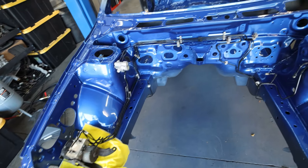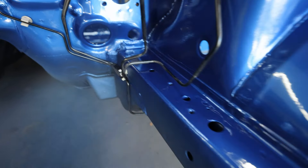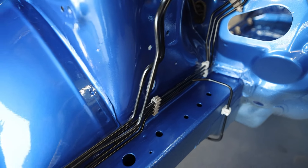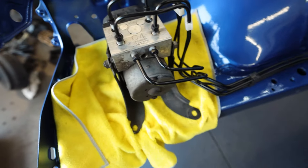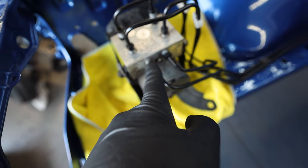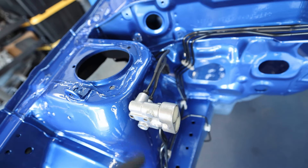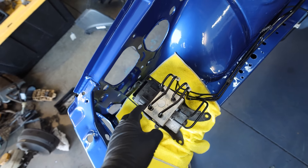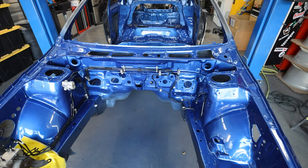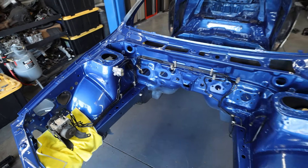It's a little confusing to explain, but you've got this one swoopy line here that comes down to the front left. You've got these two right here which come up, come around, go down with the giant bundle, come up, and those two go to master cylinder one and master cylinder two. Here you've got rear right and rear left — those are going to go up to the back side of the proportioning valve. You've got the two hard lines that run through the car, and then the last two run to the front left and front right. The brake lines are in; they look great — they're all Cerakoted black. I cleaned up the proportioning valve as well to get that back in.